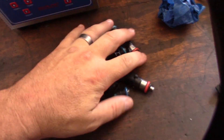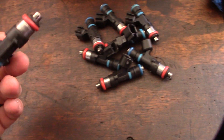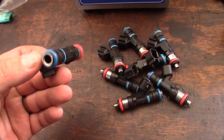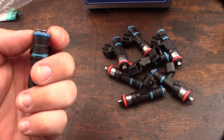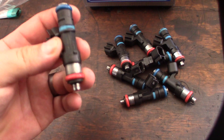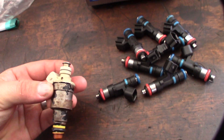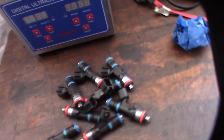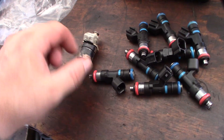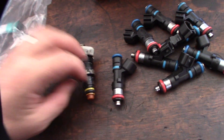These are actually off of a Chevy LS2 engine Corvette. They're anywhere from 32 to 34 pounds and they run at a higher pressure, higher PSI. I'm hoping these will be the same diameter — I'm not sure yet. I have an EV-1 injector somewhere around here, and I've got a ring to check the fit before I take the others off. That's the original EV-1 style injector; I have EV-6 on the car right now. It's the original Pintle single spray cone spray.